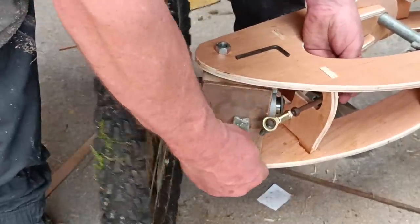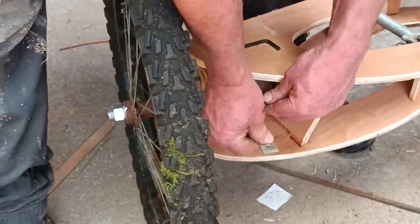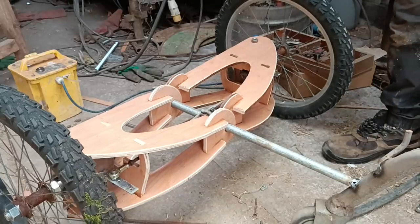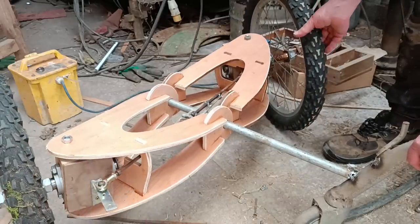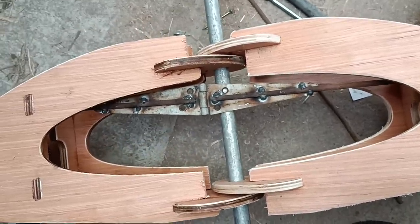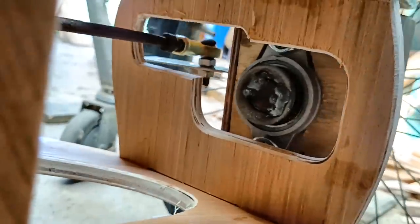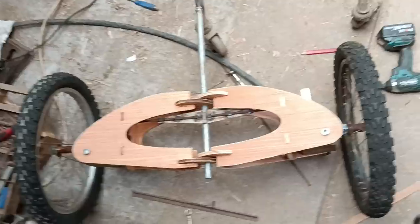Adjusting the tracking is easy - you just change the length of the arm. Now you can see what I'm heading for. Having the steering rod arranged inside the suspension arms might save a bit of space somewhere else, but I'm still looking at that. And lifting the wheel up doesn't affect the steering at all, which was a bit of a worry.